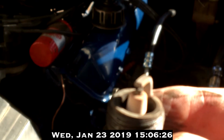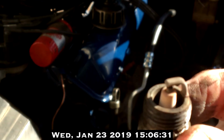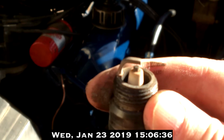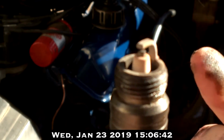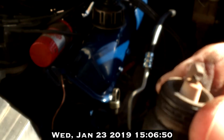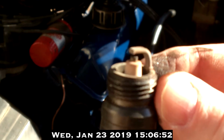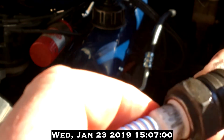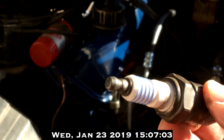and was almost too lean, which surprises me given the number of months that the car was running rich. So that's a bit of a surprise. The oil and the grease on the thread is a little bit concerning. It means there's oil in places where it really doesn't belong, but that's what happens. At least this part doesn't look too bad.